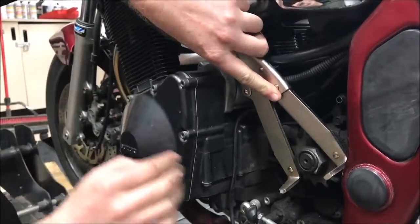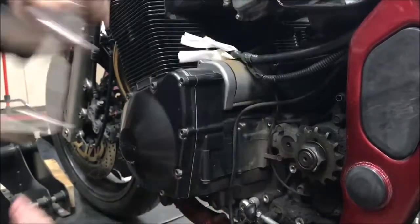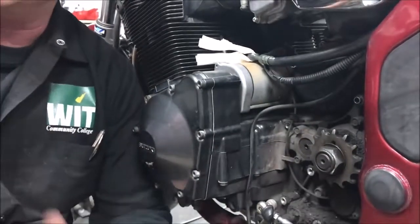This is the big one for installation as well. Whether you put the chain on or use a torque wrench, get that torque to spec. This is not one where you just let the impact honk away. If I take a half-inch impact and just blast it until it feels tight, what am I potentially hurting?